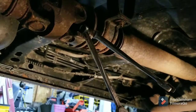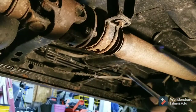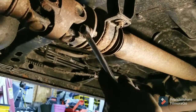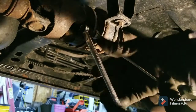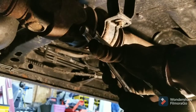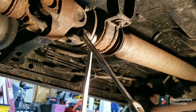I can't get an impact in here to reach these. I like these wrenches that are flat — they're twist wrenches. I put one on facing towards the truck, put the other one on the same way, which puts the flats of them close together, and then you can grab with both hands, squeeze, and get those broke loose.